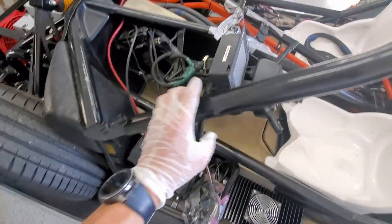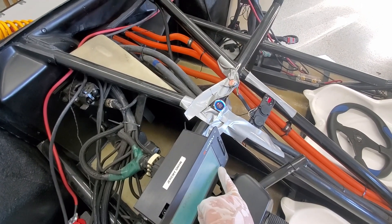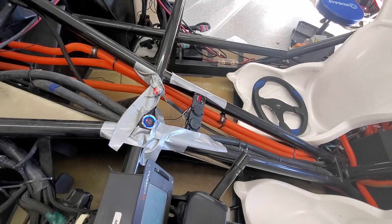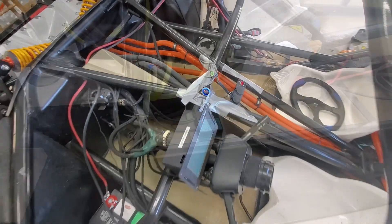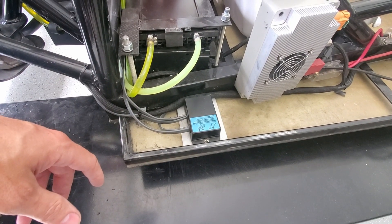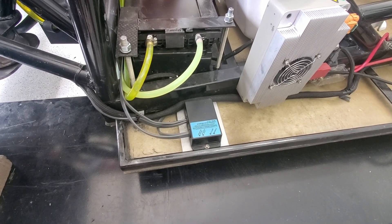I reconnected the battery, turned it on, turned off the controller so the fan wasn't blaring, and tried the parking brake again — fingers crossed. This time I heard two clicks: left and right. The controller showed green. I think after switching the 12-volt constant and switched wires, it took a little bit to relearn the calibration force, but both calipers seem to be working now. We're going to call that a win.